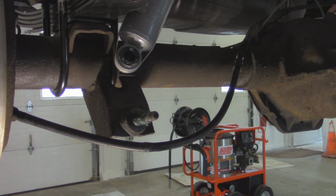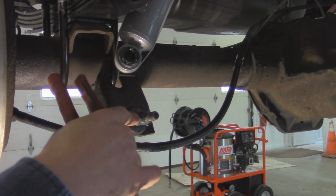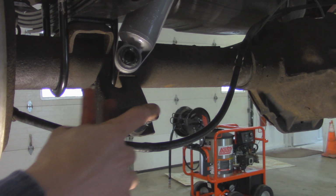Now for this bottom axle mount, I went and put some grease over here where the bushing for the shock is going to be riding on, and put a little bit in the bushing hole because this is a moving point in the suspension and we don't want our bushings to wear out right away. So I'm going to cut the strap holding the tension on the shock, and then we'll try and slip it over here.